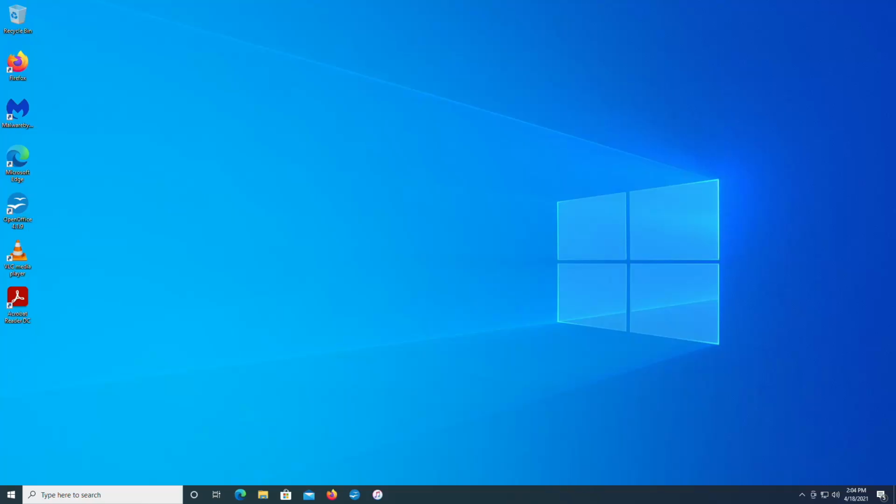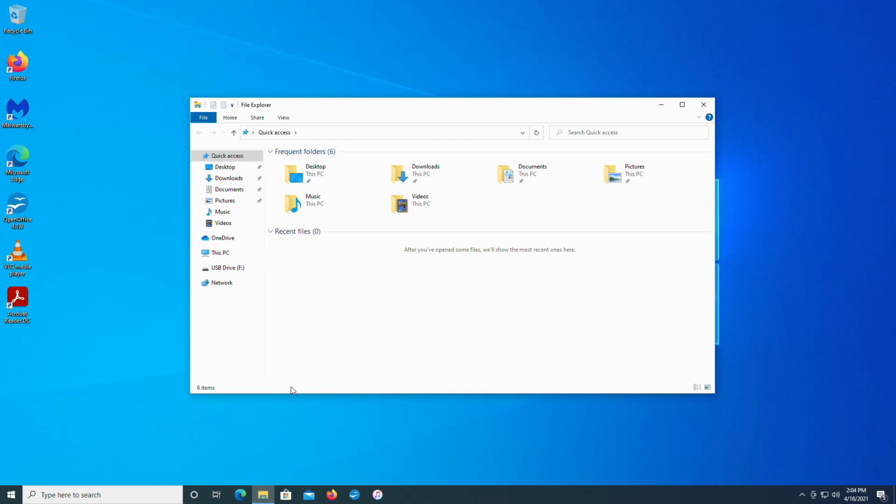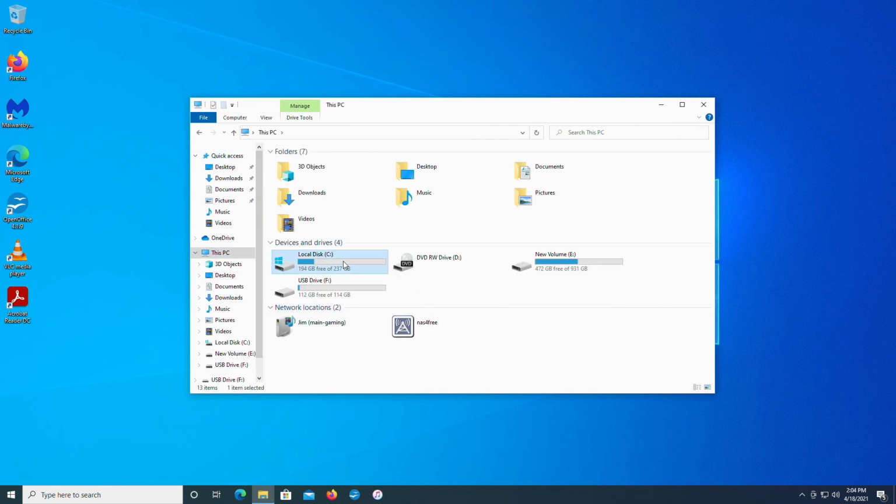Okay, here we go. This method number two, drive system. Now, this particular system I've reconfigured so that we have what you might see in a typical gaming machine that's available, which is a boot drive, which is solid state, and a storage drive for games and so forth, which is typically a mechanical drive, but not always. So in this case here, this 256 here, this is a little bit too small to effectively run Windows 10 and Linux Mint off the same drive. Got a little bit of storage constraint here.